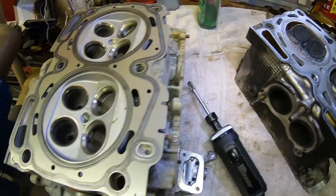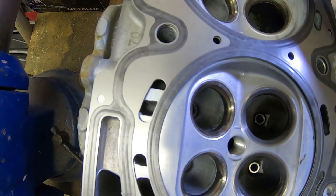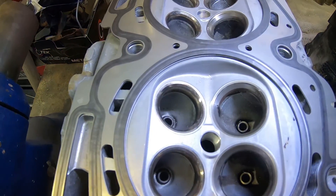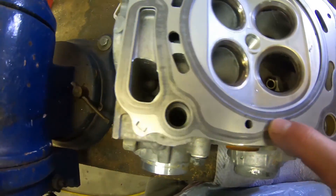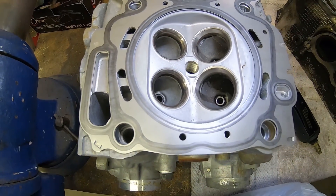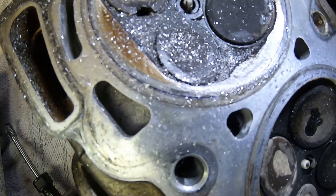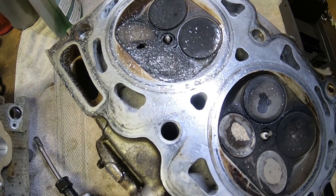When I press this head gasket in and make sure it's lined up, I'm actually not taking material all the way to the gasket — there's still a little bit of an edge there, same on this side. There's actually more of a lip on the outside, so I won't be taking material up to the gasket edge. I'll be leaving just a little bit there all the way around. I've kind of nicked both intake and exhaust valves, which is fine — I may have to get some new intake valves.